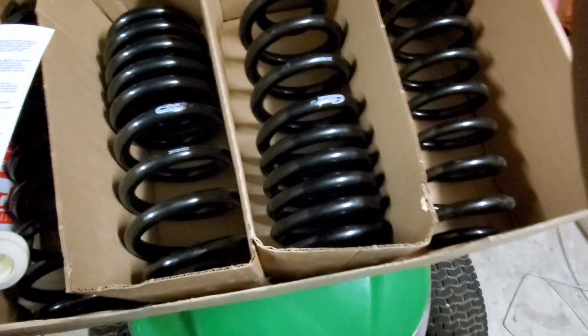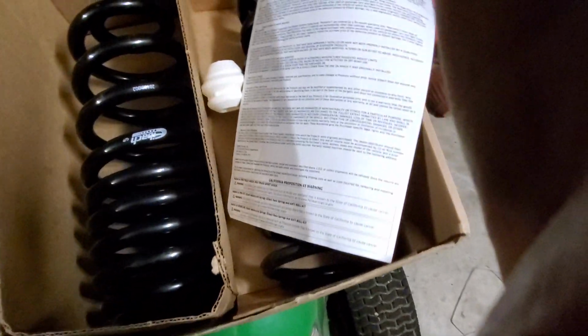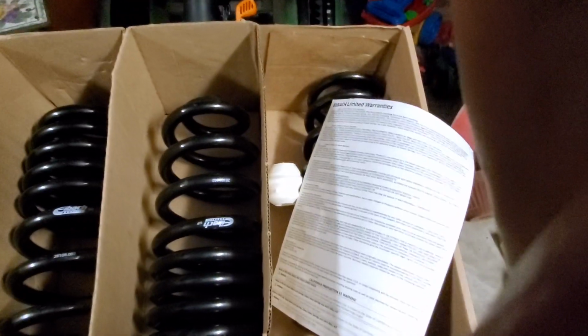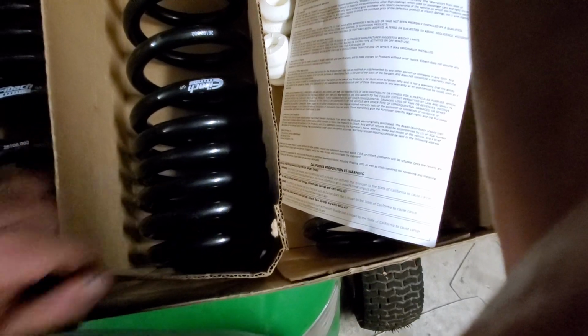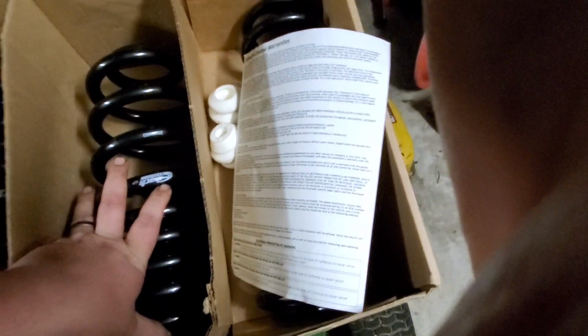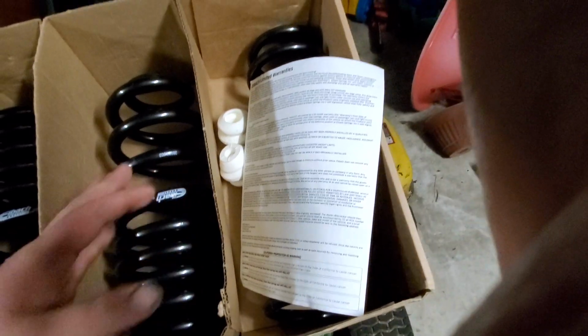Now, a lot of guys, especially the Dodge Durango RT owners out there, that's the biggie. RT owners will know that when you stomp it in a stock exhaust or stock trim level RT, that thing squats. You could feel a lot of front to back movement. The back likes to squat down on these. So going from the stock spring to this one here, which is, like I said, a progressive rate spring, is going to help to eliminate that and put the power to the ground, because the less that weight transfers to the back, the less energy it takes to move that vehicle forward.